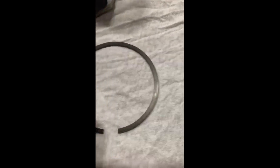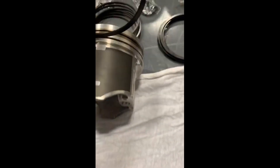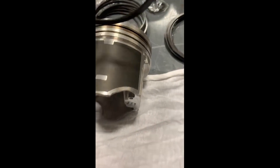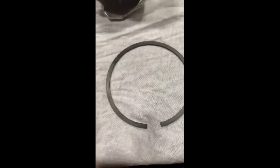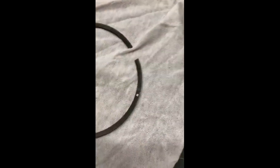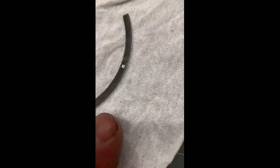We use all Mahle pistons here and you can see that chamfer on the actual piston ring — this is your second ring. Make sure you guys put them in correctly. They go in there and like I said, that's the top, so this would be facing upwards on the piston. And on the top ring, they're marked with an M. That one goes on the top.